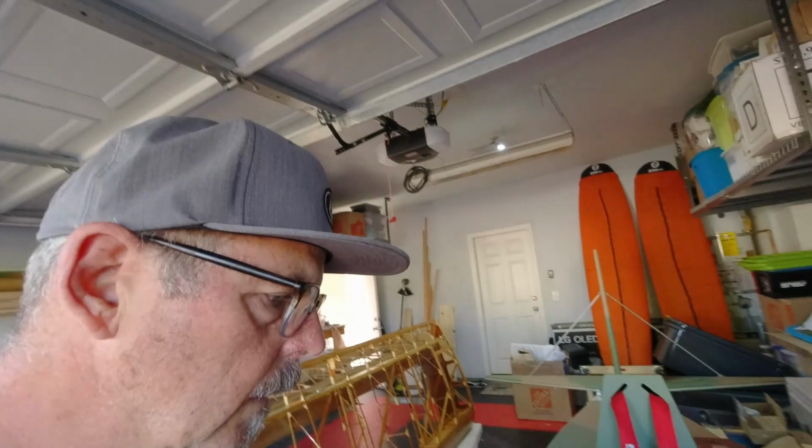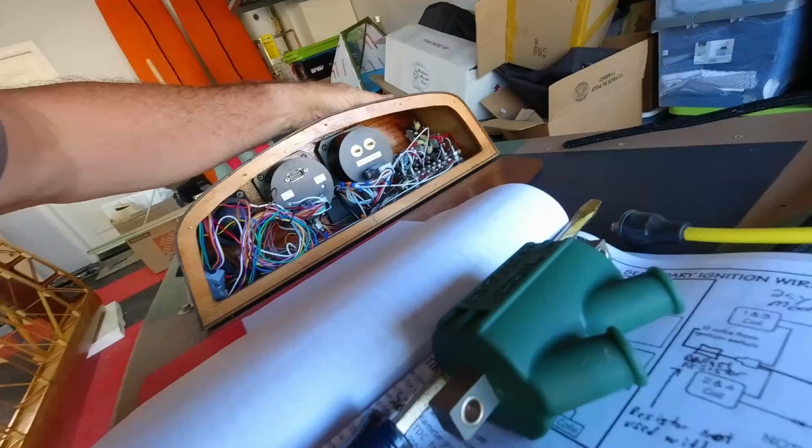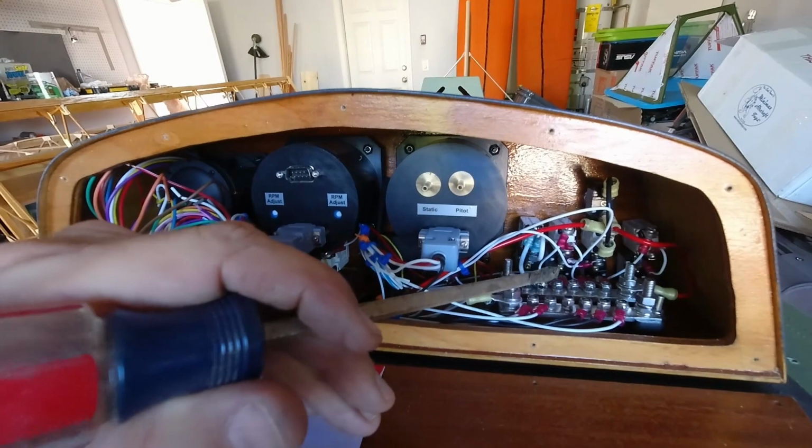And I've only got one lead coming for the second ignition. Let's see, ignition two. It's my third switch. So one of those, the top of the switch, is already going to the positive terminal. My battery's not connected, so it's coming off the top of the switch, and it's actually going to this terminal right here. So that's already connected. That's why I just have the one wire.